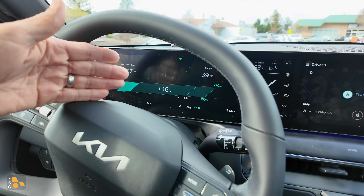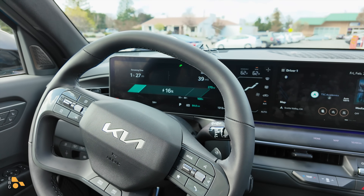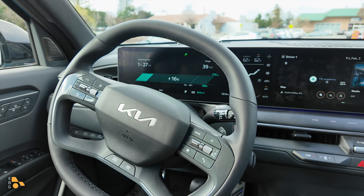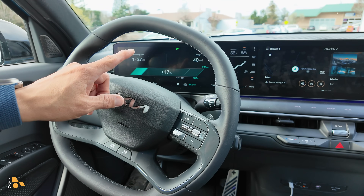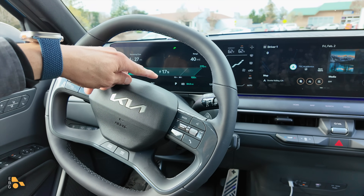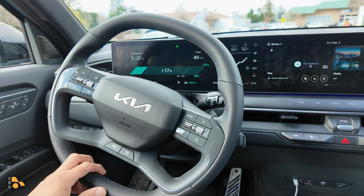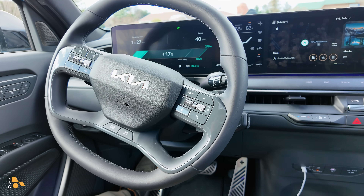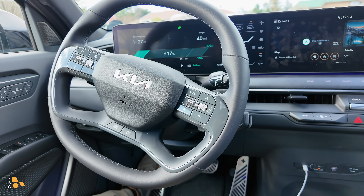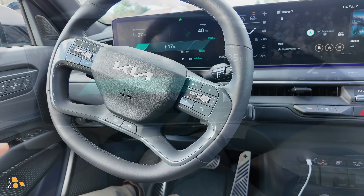There have been some software limitations in the past by Tesla stations because of the nature of the conversion circuitry onboard modern Kia and Hyundai EVs, which has limited the power output. We don't have any official confirmation as to whether 84 kilowatts is the new limit or whether that's just the maximum this vehicle could do. Theoretically, this should be able to do about 100 kilowatts, although I cannot get anybody at Hyundai or Kia to officially confirm that — they've been pretty cagey on the totals.